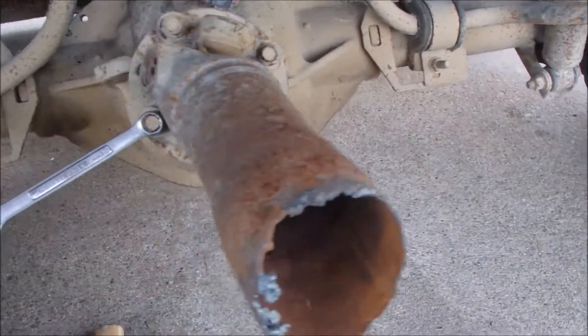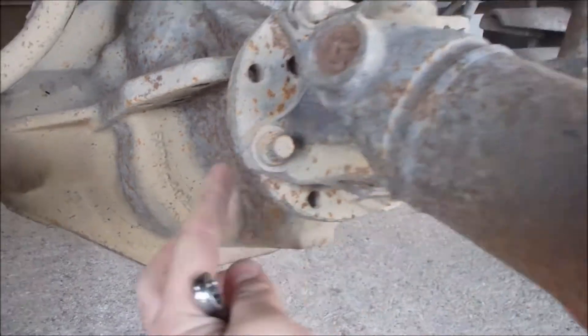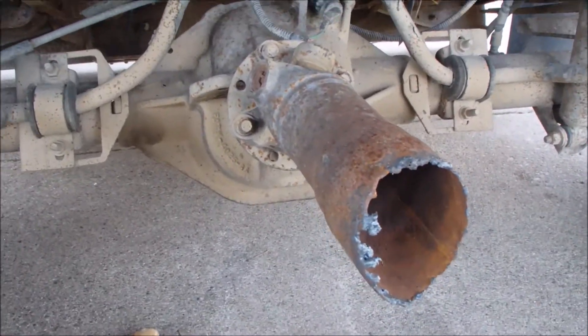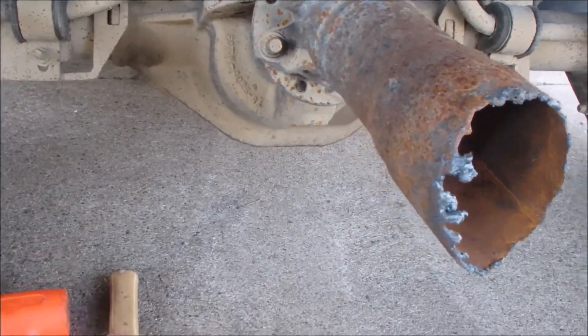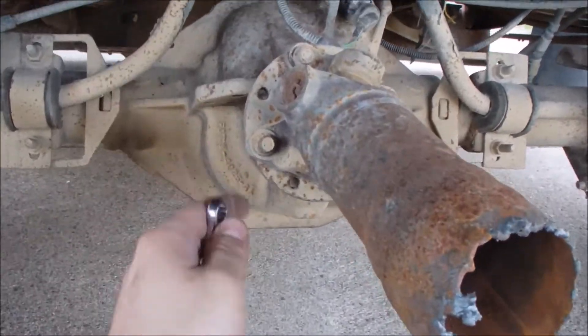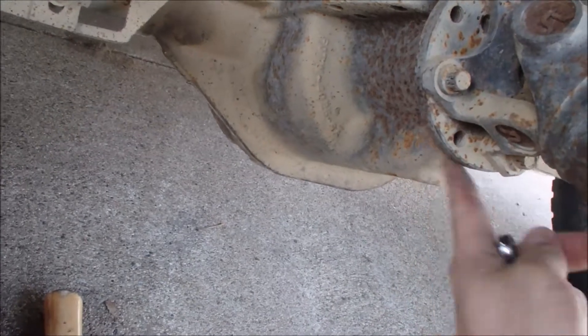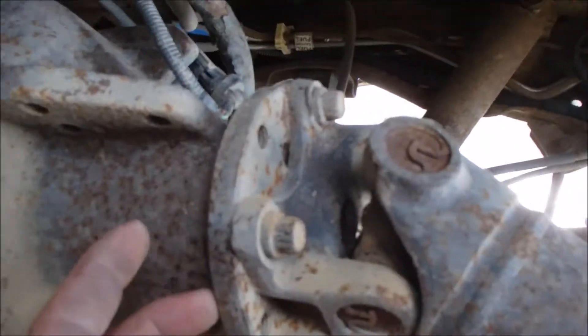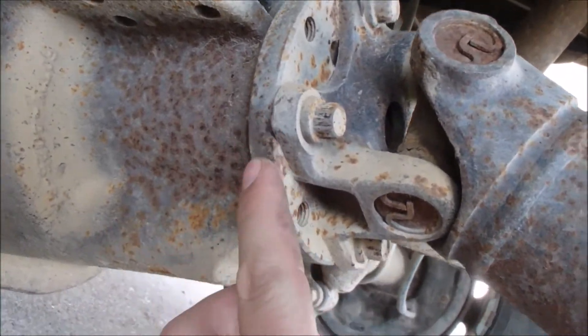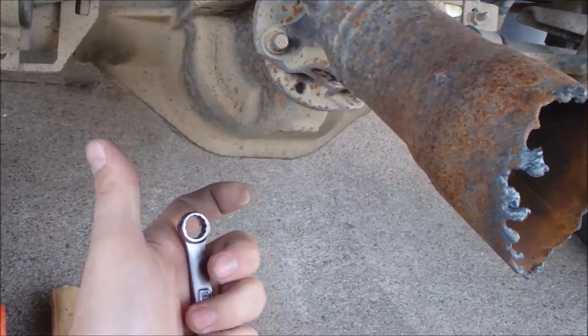Removing drive shaft bolts. The first thing you're going to want to do is on the back side, and probably the front, however you can get at them, spray penetrating spray. I did that over a couple of days. I actually couldn't get these loose when I tried it. But another thing you can do - this piece back here - you can heat that up, right here. I usually heat it and let it cool and that usually cracks stuff loose.